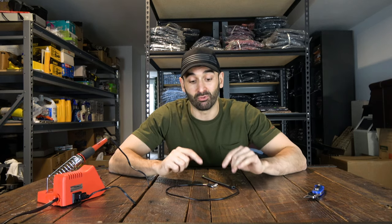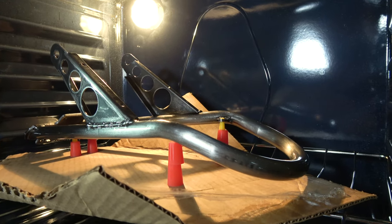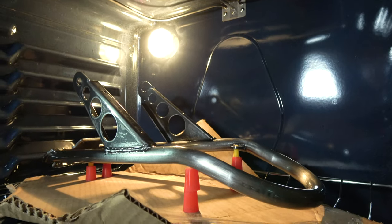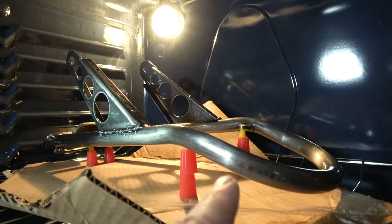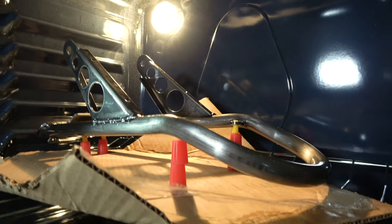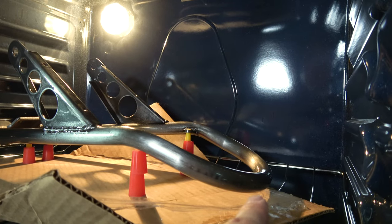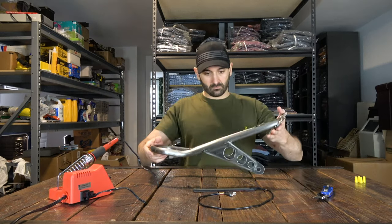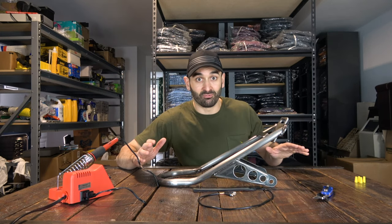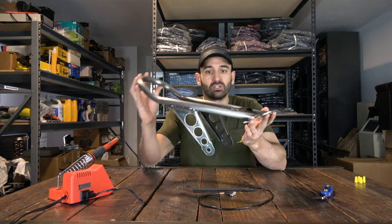It's been almost three hours that the subframe has been in the oven — a regular kitchen oven, nothing fancy, not a painter's oven. 175 degrees Fahrenheit for what was supposed to be two hours. The subframe is set so it's not touching the cardboard — you see the red bases here, the cones, and yellow ones up in the screw holes to keep the subframe in the air — because previously when the subframe was just on the cardboard, the paint melted. Let's take it out and inspect the result. I am super happy — it is super smooth, super shiny. I'm blown away by my spray painting abilities, it's getting better.